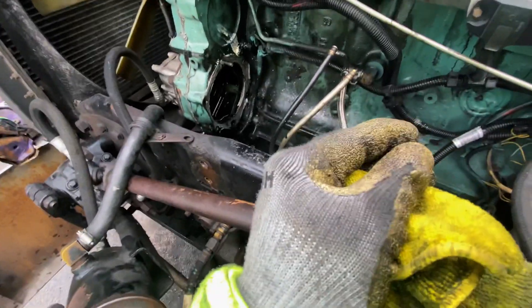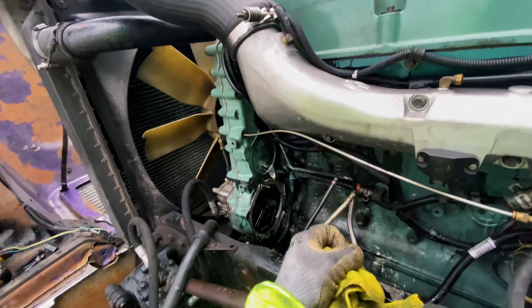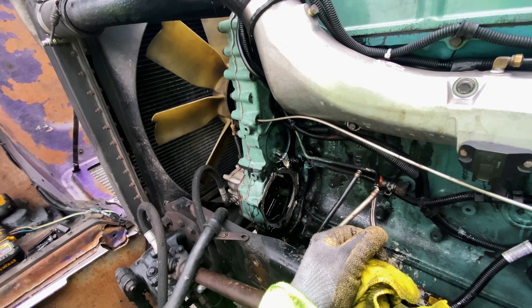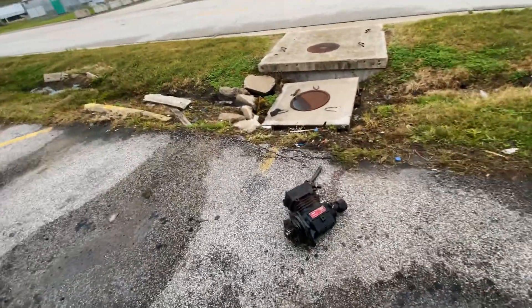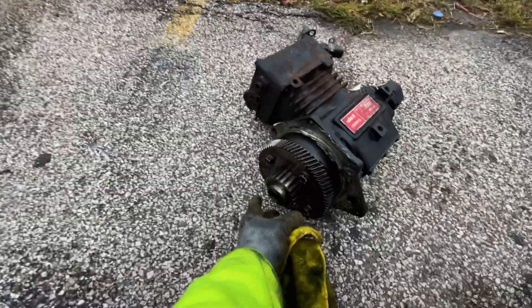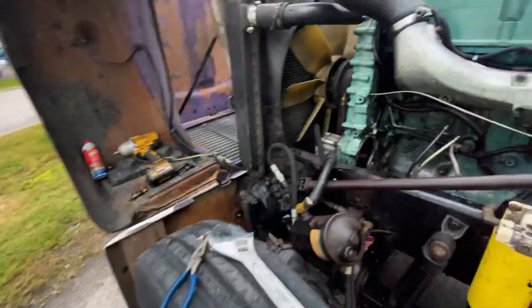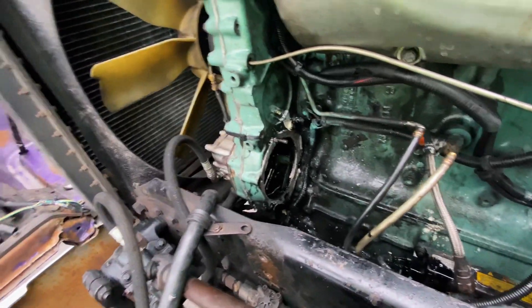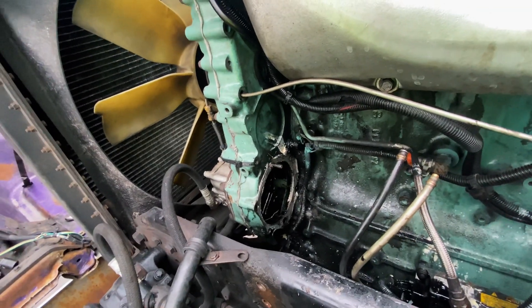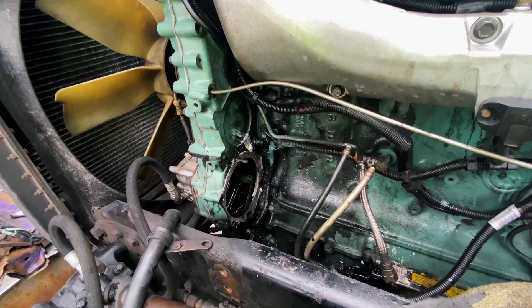As you can see, it clogged it up and then it poked through — especially this Permatex that dries fast. I think the Detroit gasket maker isn't as bad. But definitely do not put a lot of it. This thing was heavy, and then you have these gears here that have to perfectly line up. This here goes into your power steering pump, which is on the front. You've got to find a way to line them up, or just remove the pump, which is what I'm going to do. Then I'll ride to Freightliner to buy some gasket maker and some hoses.